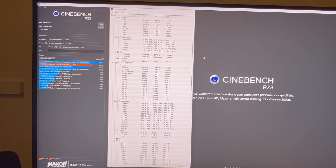If you have any questions on the settings or anything like that, let me know. One more thing — I did have to add an AVX instruction offset of 8 in the BIOS. I'm going to mess with that to see if I can lower it down and still pass the test, because I was failing with no AVX offset at a lower core voltage of around 1.32 volts. So it looks like 1.360 is what I needed to pass and get the score I did.